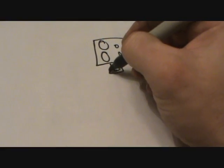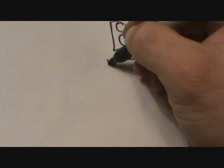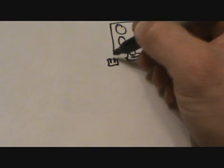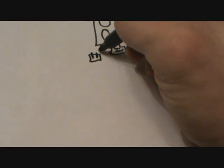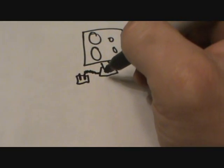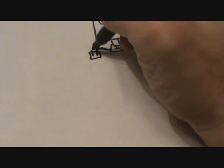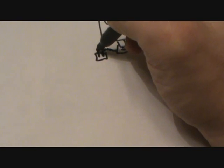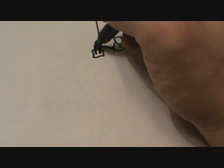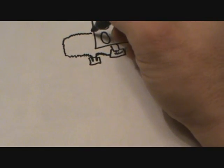So what you'll have is a connector, which we just saw here, and then on the intake manifold of the engine you'll have a little thing that has two connections on it. It's a piece of metal sitting in the intake manifold, with two connections. One of these connections will go directly to the heat stove, the choke stove on the carburetor. Choke housing, excuse me. It's been a long day, guys. Sorry about that. Then the other one will have either a metal line or a rubber line. You can use a rubber line, it doesn't really matter, but they came from the factory with metal lines, so try to use that if possible. And it will go somewhere to the carburetor.